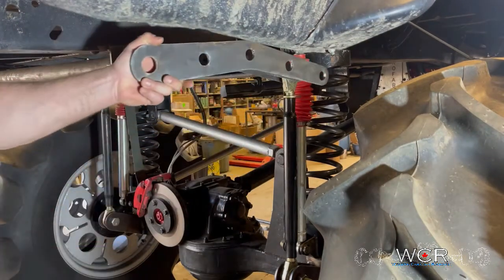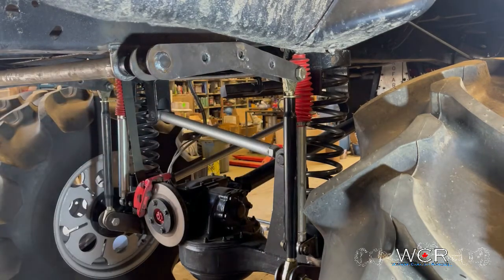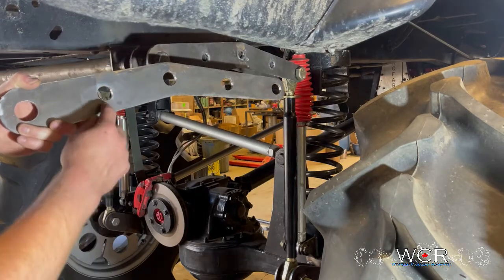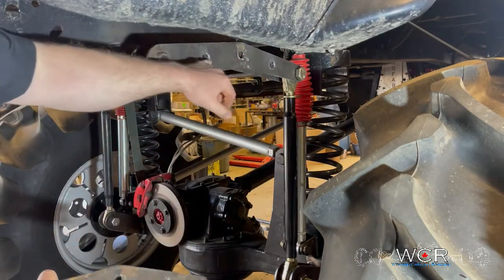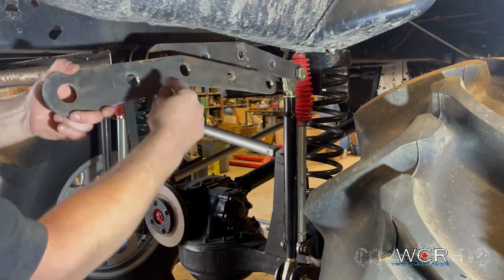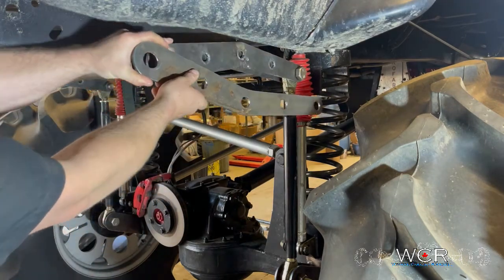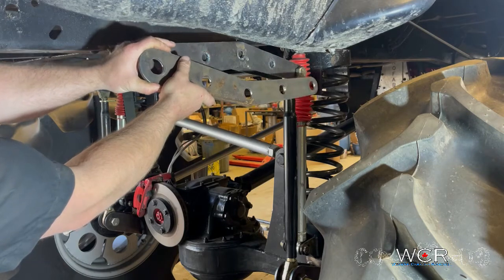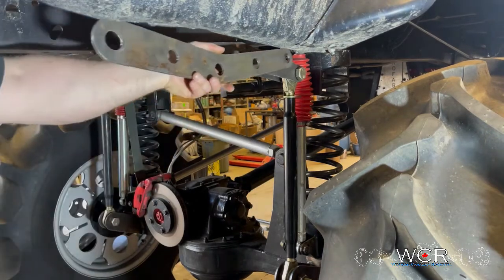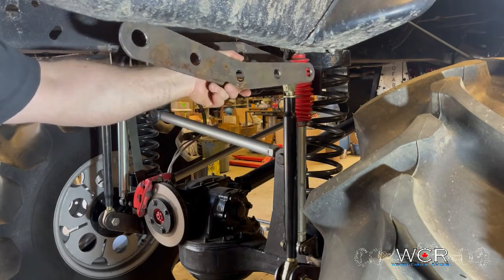The arms that come in the kit are designed so the GM torsion bar slides through them, welds on, and then a bolt goes through for your adjustable link. The one inch tubing supplied in the kit welds into the holes here just to provide a little bit of strength for the arms. It doesn't matter which direction you mount the arms — we put a little bend in them to make them more universal. The only thing you want to try to do is at ride height make sure the two bolt holes are level, so if you drew a line between them they'd be level. That gives you the best angle at full compression and at full droop.